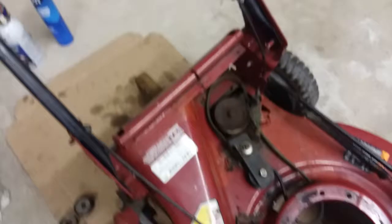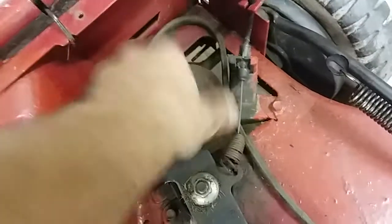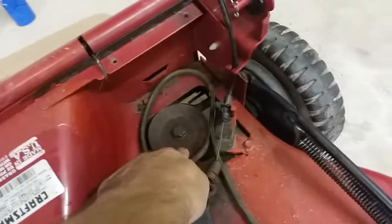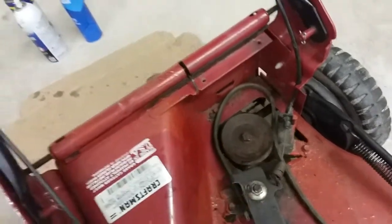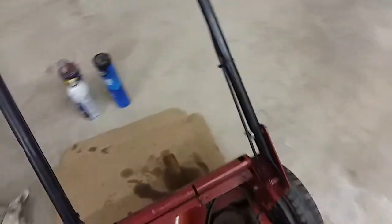The way to tell — I've taken this cover off. If it doesn't work when you spin this, which is where the belt would normally turn, you can see how that wheel is moving, and over on this side that shaft is moving. So the problem is not with this. In that video I did of the green mower — the Craftsman — talking about these MTD transmissions, I said I've never really seen one of these go bad. I've seen them locked up and stuff like that.